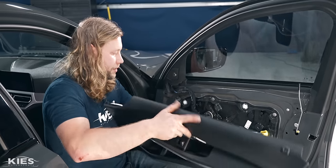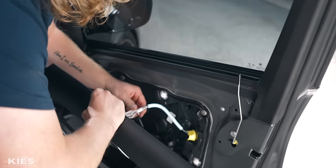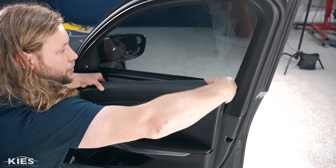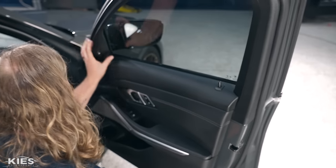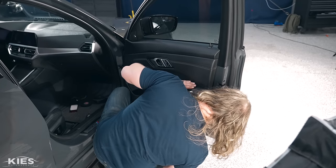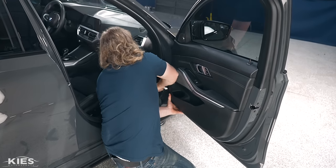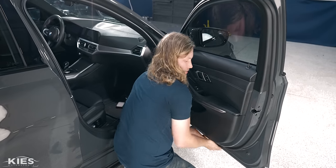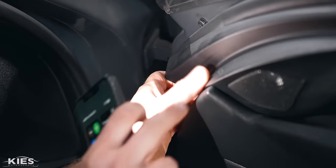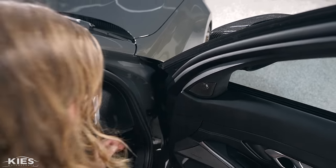Reconnect your electrical connections — the main one just clips in, and the other one slides in and presses down. Then make sure you go up and over your door lock indicator, push towards the window, and slide the door card in. Once you've done that you're ready to start locking it in — just make sure everything is lined up first, take a peek, and then get everything clipped back in. Make sure this piece is on the outside of the door card otherwise the clips won't seat correctly.